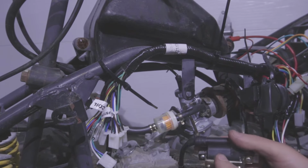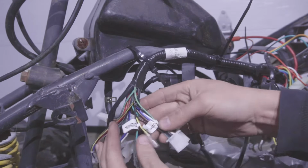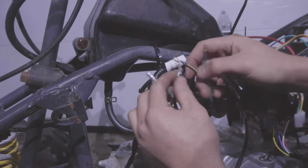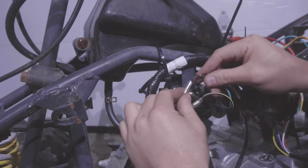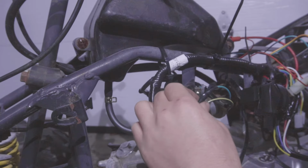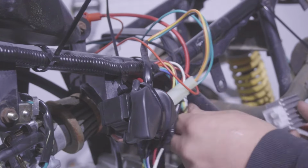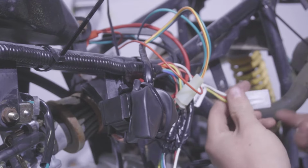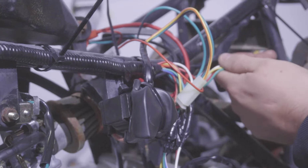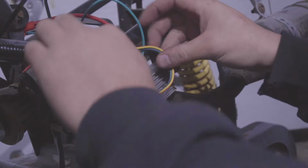Put on the coil. Gonna look at the front of the harness, find the 2 wires for the coil. Just gonna connect them, black and yellow with the black and yellow, green with the green, and a little bit of electrical tape just to prevent any mistakes from happening. And that's good to go. Right there like that. I'm gonna face the rear, go to the rectifier, clearly marked. It's so simple when everything's marked. You don't have to look for anything. It's not a big mystery. I'm gonna set the rectifier right there, where it's gotta be.